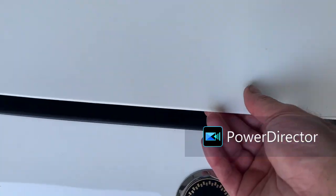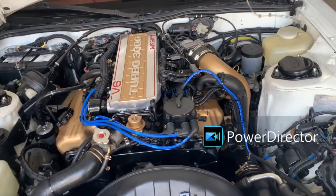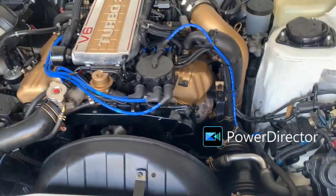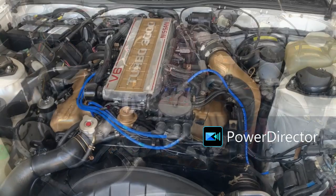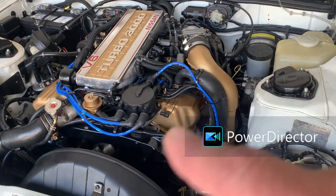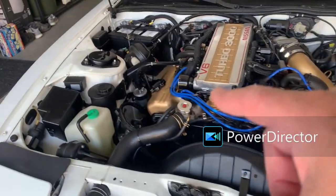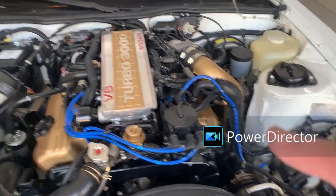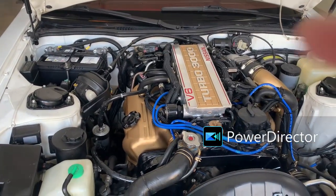Let's have a look under the hood. Same engine, but a staggering amount of work done under here. Most of the consumables have been replaced as a matter of course: timing belt, water pump, thermostat, idler pulley, camshaft seals, leads, plugs, rotor, valve cover, and valve cover gaskets. It's got a new alternator, new or rebuilt starter, new battery, and a new oil pressure switch.